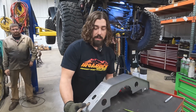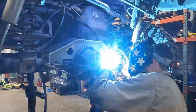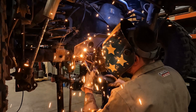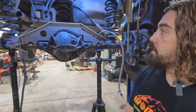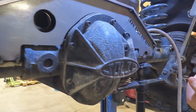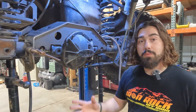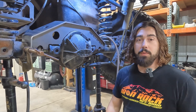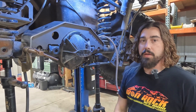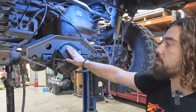We're all cleaned up and ready to put the truss back on the axle. I can turn a wrench and use a grinder, but when it comes to welding, I'm going to hand it over to our lead welder Ryan. Ryan just completed his first run at the truss — you can see he's done a ton of tack welding, making sure everything is where we want it before we commit to full passes. If you get too ahead of yourself and something's wrong, you've got to buy $500 worth of grinding wheels to cut it all off and do it again. So take your time, do the tack welds, get it mocked before you fully commit.